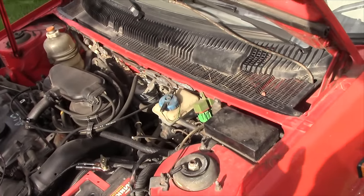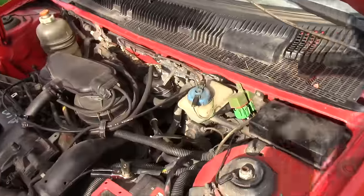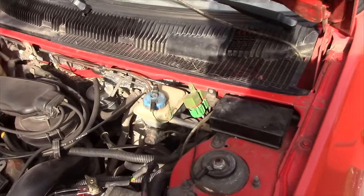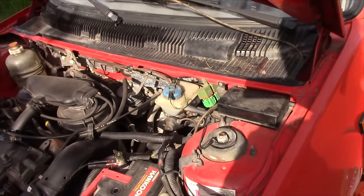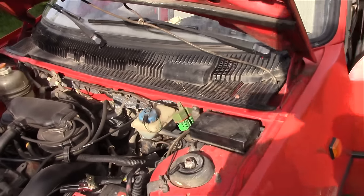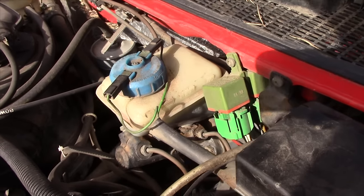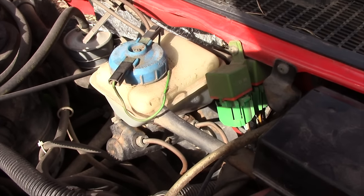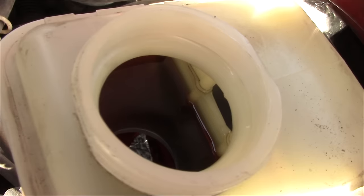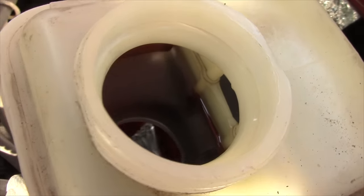I do have some form of excuse, since I have somewhat recently flushed the brake system in this vehicle, and the light didn't come on when you actually pressed the brake, which would cause the level in this reservoir to go down — it just came on randomly during driving. So we might actually just be dealing with a bad sensor, but given the rather low amount of brake fluid, I'd say we're probably dealing with a low brake fluid alarm. Let's top this off and see if it goes away. I think it might actually be time to do another brake flush because this fluid looks quite nasty — very dark and brown.